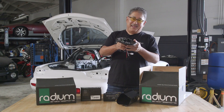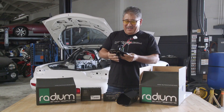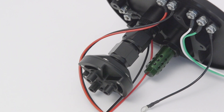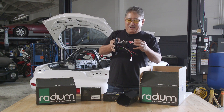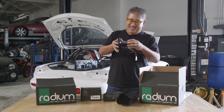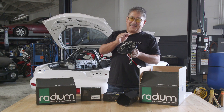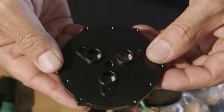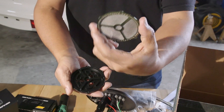This is the top plate — it replaces the top plate of the RX-7 fuel tank. It's made out of billet aluminum. It has the hangers for up to three pumps, and there's a manifold that you can attach all the pumps to. You can run one or as many as three for a real high horsepower application. All of the pumps go into this clean manifold — no hoses, no tangling, nothing to leak — and it can go out through this AN fitting to your fuel rail. Nice and clean. On the bottom there's a stainless fuel screen with locations for all three pumps to pick up. Not that cheap cheesy nylon mesh that messes up after a while.